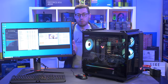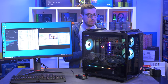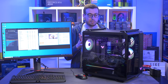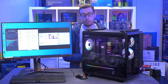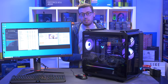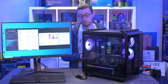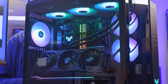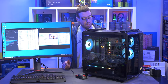We now have the full build done and benchmarks complete. This build is exactly what I wanted the original TUF one to be — a 360mm radiator, higher-end graphics card, and higher-SKU CPU, and it's turned out bang on. It did take ages to decide about the vertical mount, trying loads of different ones — that's what dragged out the video. I've settled on the Phanteks one which I think looks nice at an angle, and certainly very different from other TUF builds. For temperatures, the CPU hit a high of 96°C.